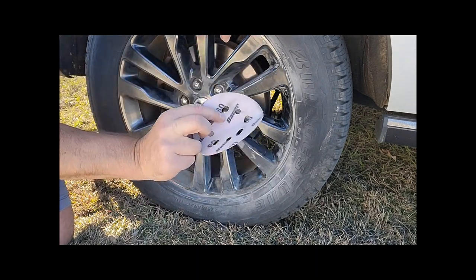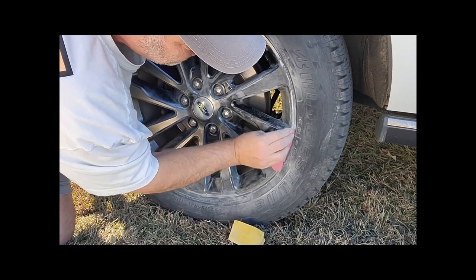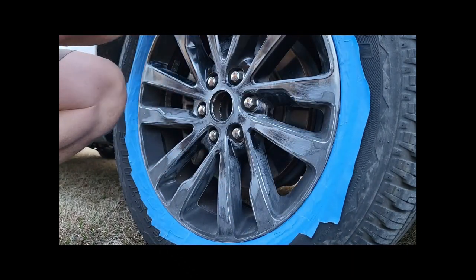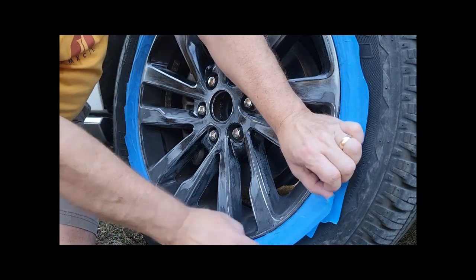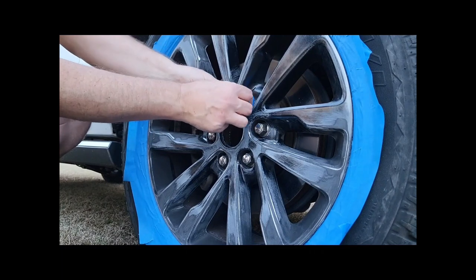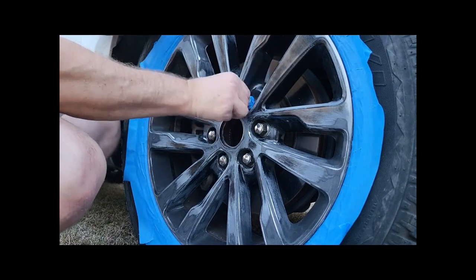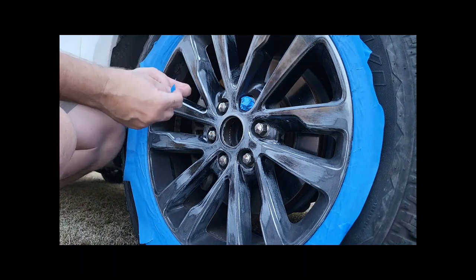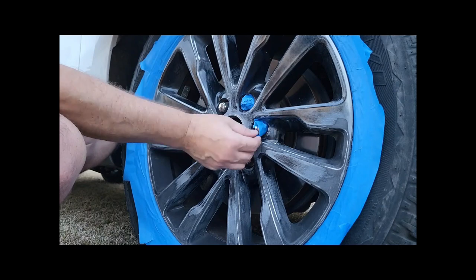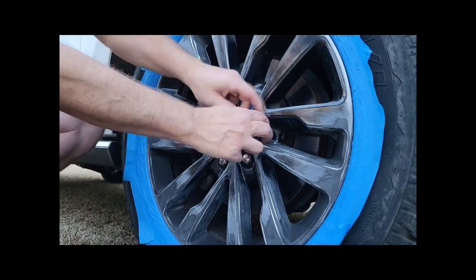Here I'm making sure everything is smooth, going back and checking the whole rim to make sure I didn't miss anything. Once it's smooth, I clean everything off with a wet towel to remove all the dust. Then I put painter's tape on, tucked underneath the rim so I don't get any paint or primer on the wheel itself. I put two rows of tape on to prevent overspray, and I also tape off the lug nuts, the stem, and the tire air stem — getting it all prepared and ready for primer.